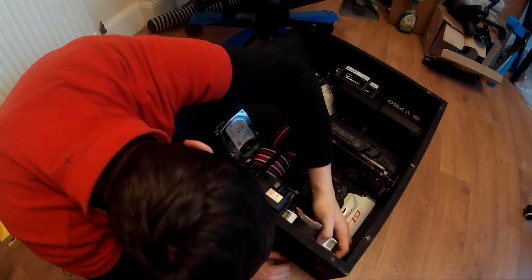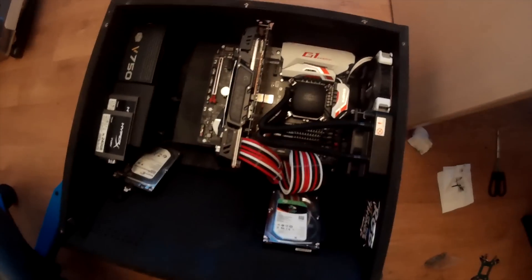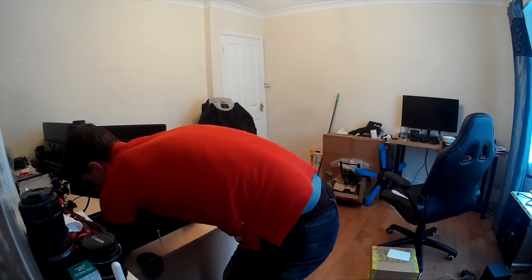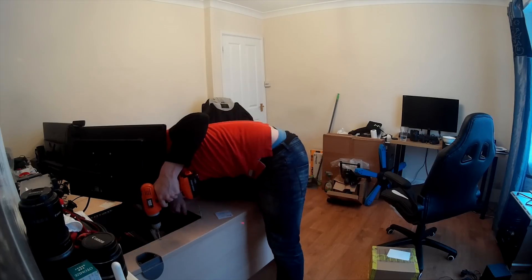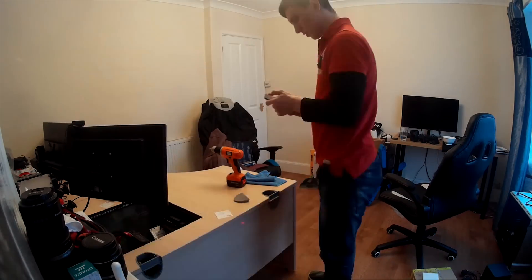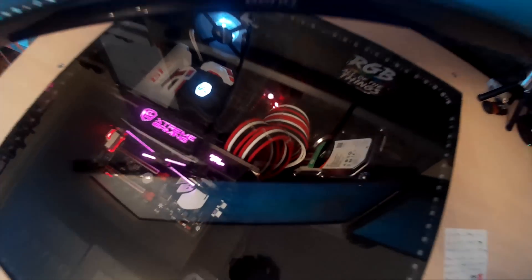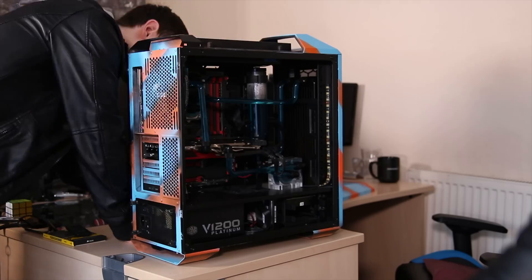As you can see, I've added a Corsair ML series 120 fan as well as a Neptune 120 XL. This has been a really great option — there's now better airflow over the motherboard and to the GPU while still keeping the CPU nice and cool. I've also added my 2TB editing hard drive and created a separate Windows profile for editing so I can have a separated workspace while maintaining easy usage. Thanks to my partner helping, we were able to attach the box to the desk relatively easily. I do really like the styling, it's decently quiet, and I've saved about 5 degrees on the GPU temperature while keeping the CPU temperature nice and low.